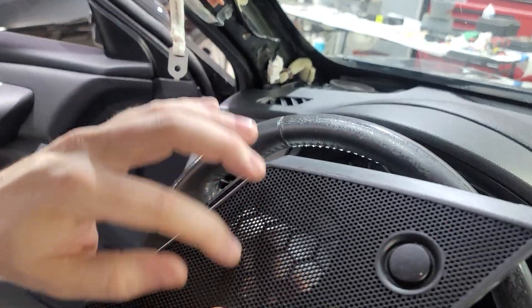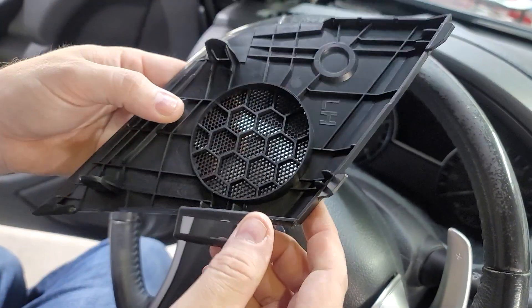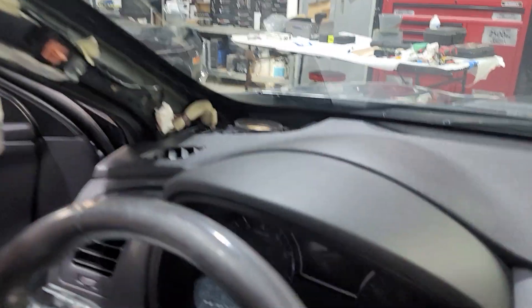That's the biggest thing — a lot of these cars, you got to be careful with the way they make these hexagonal patterns because if you push on it too hard the dart will just break off. Especially with older cars this gets brittle and it will break. Especially S10s — they're the most notorious for it.